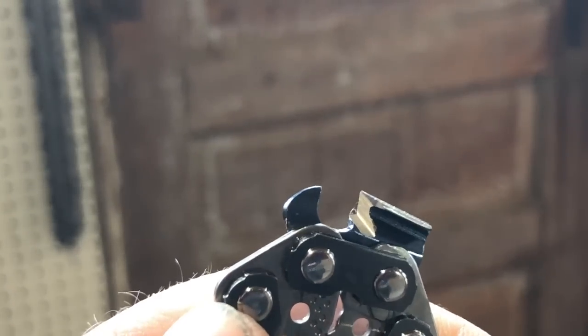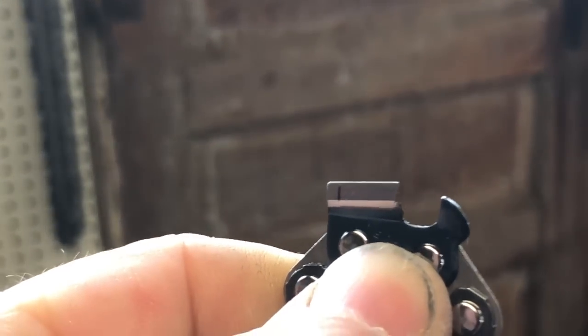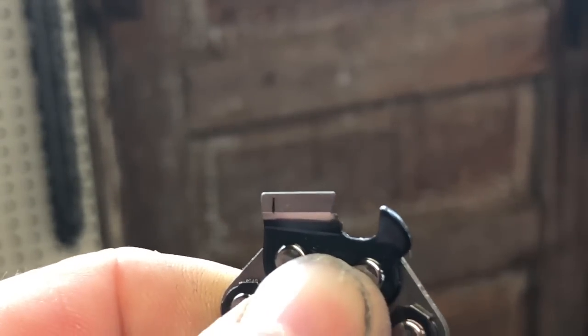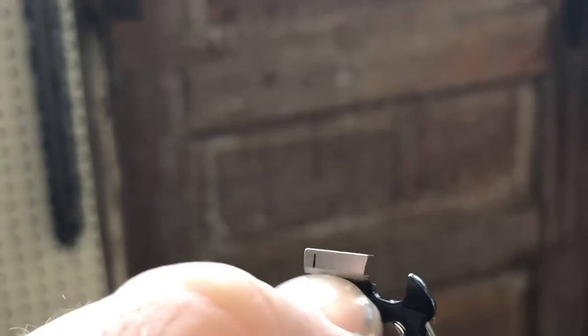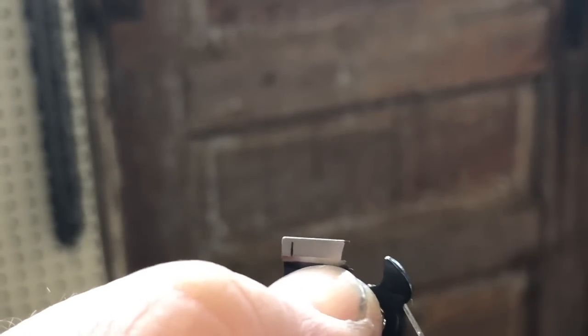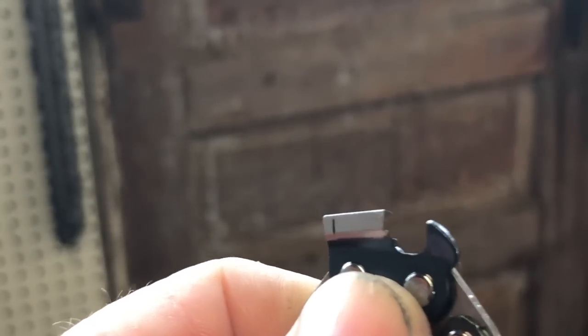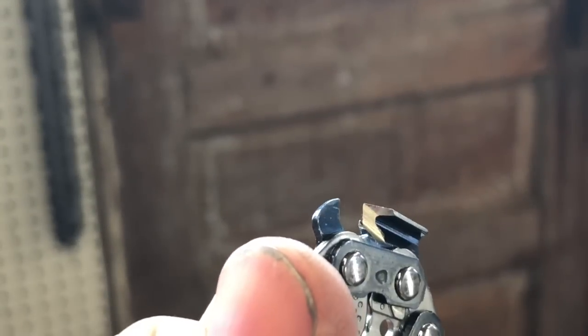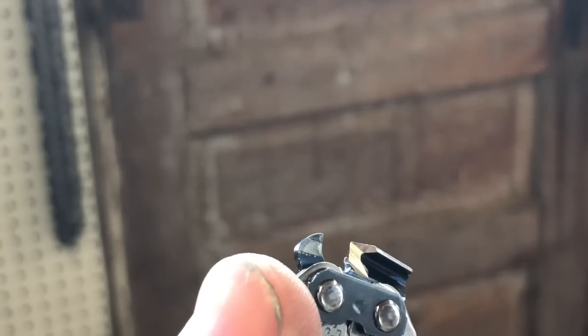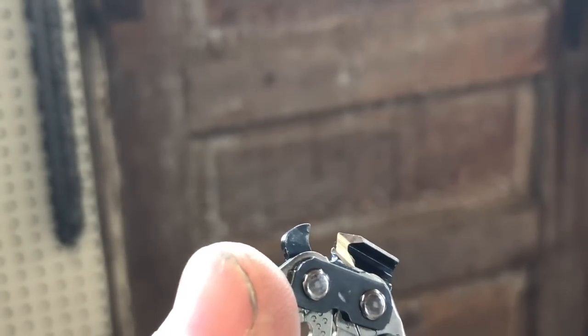There's no roundedness to the gullet. If you look to the side, the gullet just comes straight down. Well, not straight down, it's actually angled back a little bit. And underneath that shelf, that would be your gullet. As you file this tooth back, you remove this lower portion also with a hand file, but we're not talking about that today. If you can see on this, there's an inside line from that point down to the inside corner of the tooth.